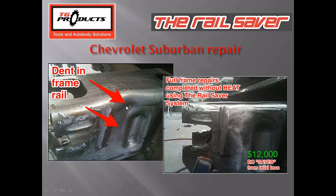Here's a full frame repair I had in front of me when I was a body tech — a Chevy Suburban with a dent in the frame. The estimator wrote the part up to replace because the energy management zone was leaning in. That replacement was going to push the vehicle over the total loss threshold, and the shop already had $6,000 worth of parts sitting there. I took another look and noticed it was just a dent from a fog lamp mounting bracket attached to the front bumper reinforcement. We changed it from replace to repair and removed the reinforcement.